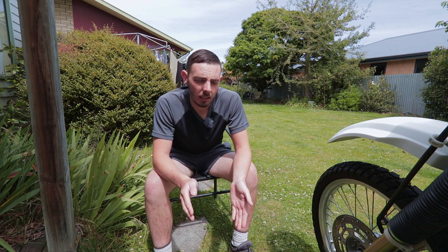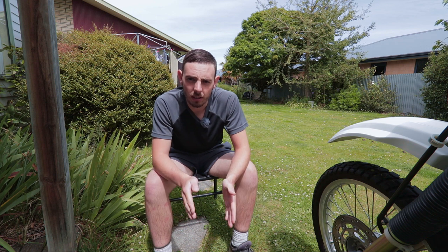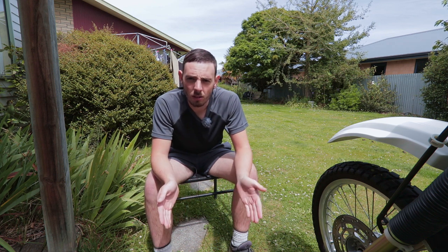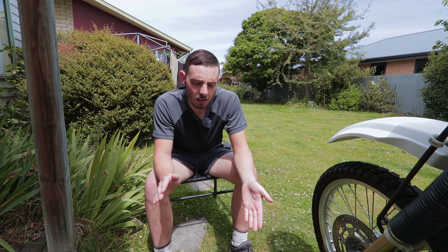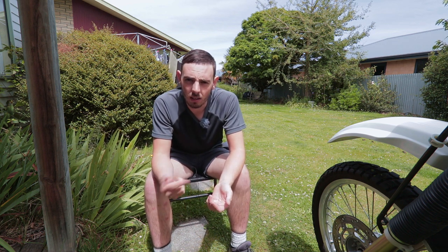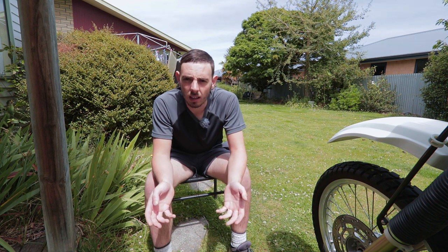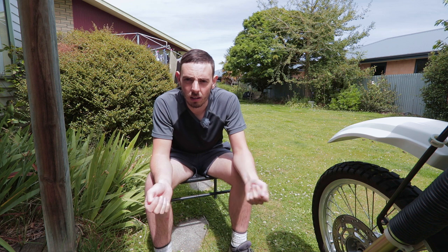If you lower it the quick and easy way, your suspension still has full travel yet you've got less ground clearance. So what can happen in an extreme circumstance is the sump can hit the ground, or the rear tyre could hit the underside of your wheel arch. That would be, in the worst case, what would happen — which is obviously not very good.